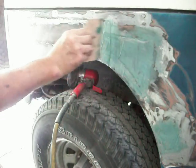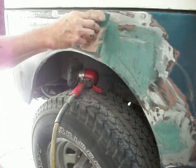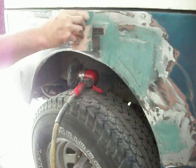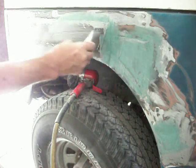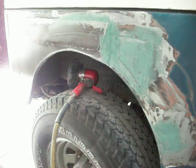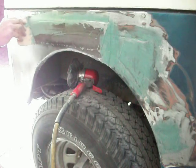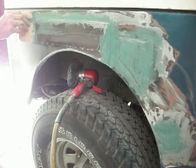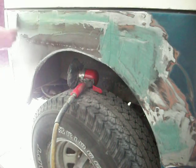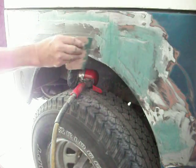You can see that that's covered. Put a little bit more on the one edge and run that along there. I'm moving in a downward motion as I go, and that's forcing that fiberglass to go into the welds. Watch the tip of my tool — you'll see how I work it downward. I start up high and I go on a slant downhill, because what that does is it forces the fiberglass into the weld marks.